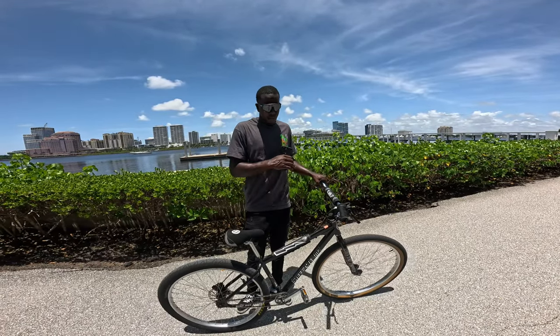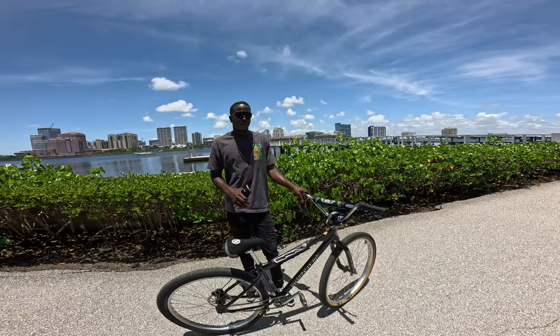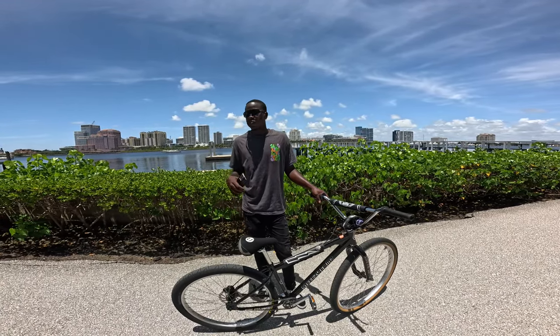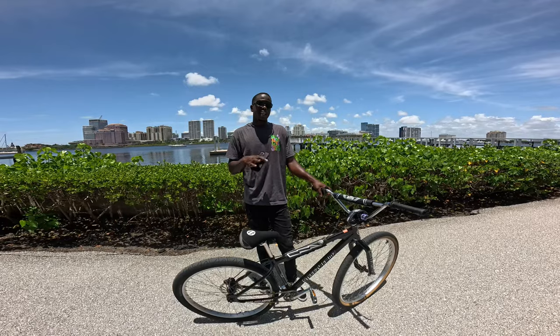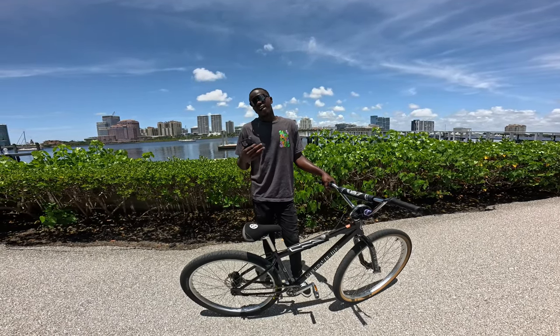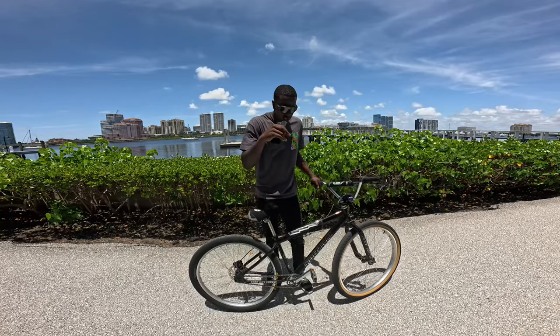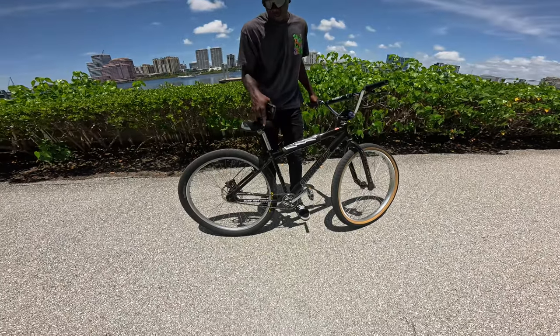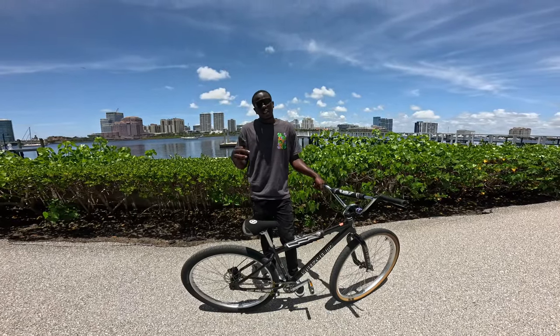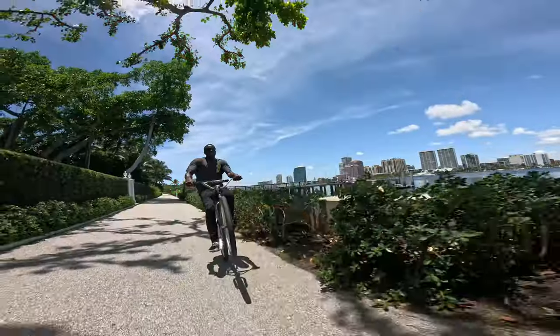Anytime someone gets a big ripper, I recommend they get any kind of loud freewheel. I've always gone with the Ride Out Supply freewheels. 15 tooth, 16 tooth, 17 tooth. They got them for any kind of bikes that you guys may wheelie, but for the big rippers, if you wanna have that best wheelie gear ratio, you're gonna go with a 33 tooth sprocket and a 15 tooth freewheel. I say it in all my videos, guys. I'm not capping. It literally will help out your wheelies, guys.